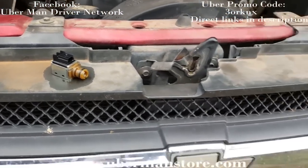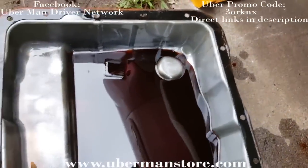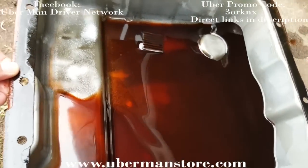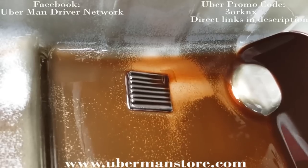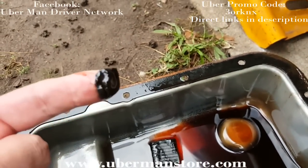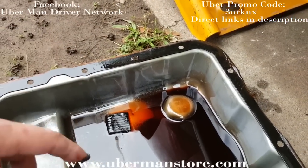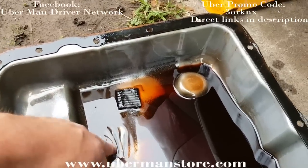I drove it around and it seemed to drive fine. This is where you find out a lot about how your transmission is doing internally — when you take the pan off. I've seen fluid in better condition, I've seen fluid in worse condition, but regardless of what the fluid looks like, what I'm looking for in the bottom of this pan are thick shards of metal. As you can see, there are none. There's a little bit of discoloration, there's definitely some metal — this is a pickup magnet — and what's on that magnet is actually a bunch of friction material. This black tar-looking goo is actually metal, and that's normal. That's what the magnet is in there for — to pick up friction material from the clutches as the vehicle is driven. As it ages it loses friction material, and instead of circulating through the fluid, we have it attached to this magnet. You get a little bit of discoloration in the pan — that's normal, cleans up.